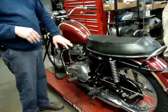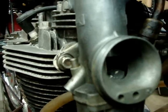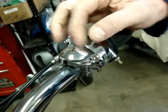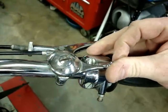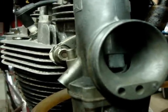Now we're going to move over here to a bike. This is an unrestored bike — just an example we're going to use. This is a 1970 Triumph Bonneville. This has a pair of Amals on it, and we're going to look in the air horn and the throat of the carburetor. When I turn the throttle — I'm just going to do this so I can lift the slide up — you can see that it's open right now. Now when we set the choke, we're going to move up here and take a look at the air lever real quick. Right now the choke is actually open. That's going to be across the bar like this.